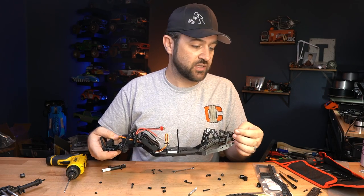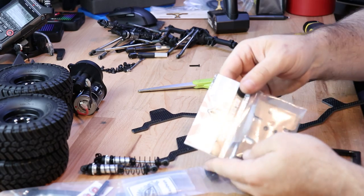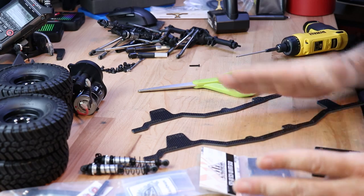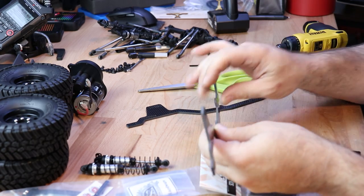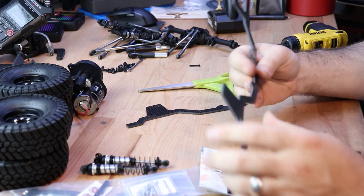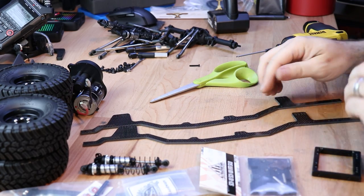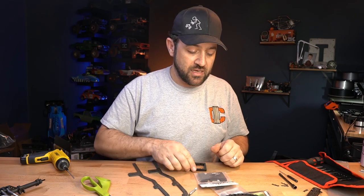Now's the part where we're going to start assembling the TGH chassis. We'll start with the new skid plate. The skid plate is going to be the widest portion of the chassis, and then the chassis will actually taper back down. Even though the rails are straight, once you start bolting things in, add a little bit of bend and curve — which is normal. Don't freak out when you have to do that. It actually adds some rigidity to the chassis by adding that bend into it.